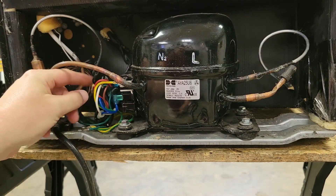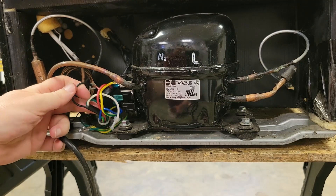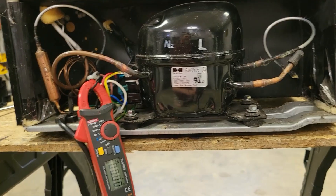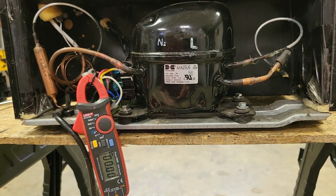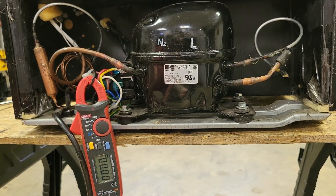Now we've got the wires exposed. I'm going to find the power cord where it comes in from the wall socket, find the black wire, and take our ammeter — set it on AC amps — and clamp it on that wire. What we're looking at is the total amps the whole machine is drawing, and the only device that draws current in this machine is the compressor. So now I'll plug it back into the wall. It's using about 5.6 amps, and we quickly heard a click, and then it dropped to zero amps.